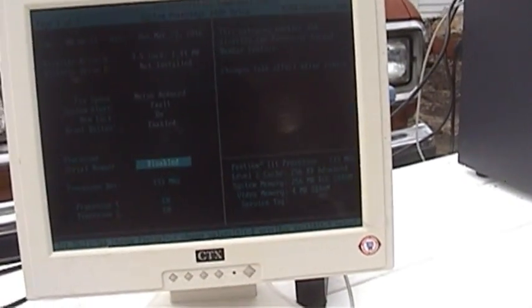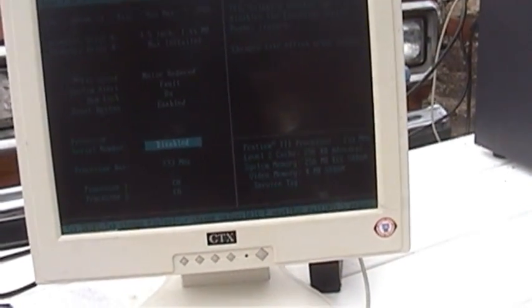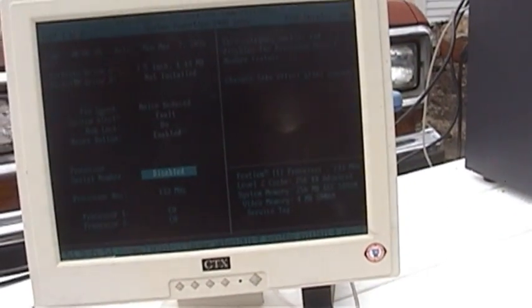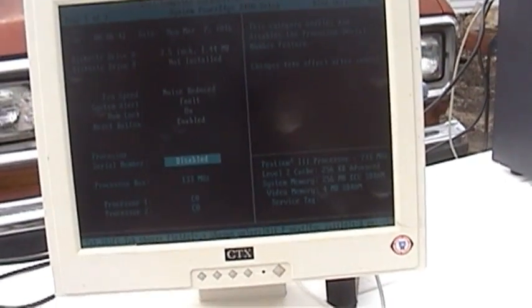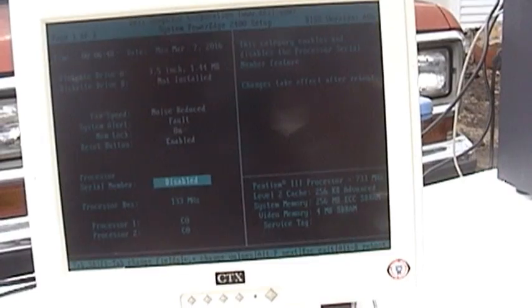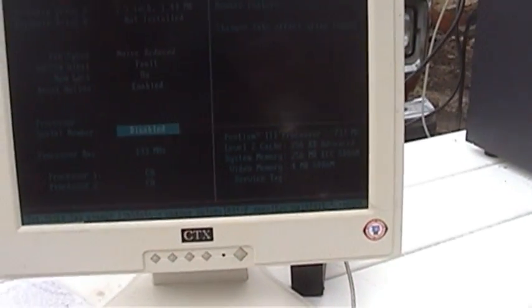Stepping basically refers to the version number of the microprocessor, because after Intel or any other chip maker releases a product, they usually discover some errata, and if it's a serious enough mistake, they'll fix it somewhere along the line and then push out a new production run of the chip. But it's a very expensive thing to do, so a lot of times they'll try to fix it in the BIOS microcode of systems that are compatible with that particular microprocessor.